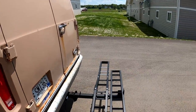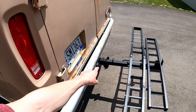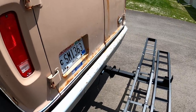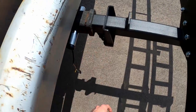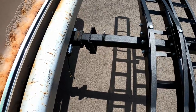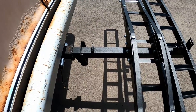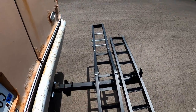We got it on the van in the receiver now. I'm going to work on tightening up that bracket - that's kind of the anti-sway device to prevent the carrier from swaying the entire time you're carrying the thing. It should tighten it up and prevent that swaying. They sent some standard grade five bolts and I have a hard time believing they're not going to vibrate themselves loose. I might use a lock nut on top of each one or maybe some blue Loctite - we'll see what works best. Then I'll pull the ramp off and see how the bike fits.